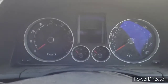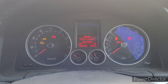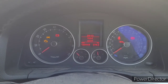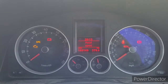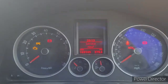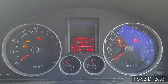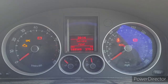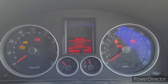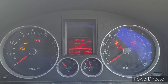This one is on 189,000 miles. The reason I had to change the crank sensor is that months ago I booted the car, nailed it, revs got to about two to three thousand RPM, and everything sort of died — all the dials flicked down to zero and back up again. It kept happening right around 2,500 to 3,000 RPM. Every time I got there, the car jerked.